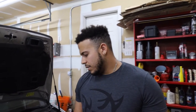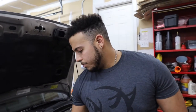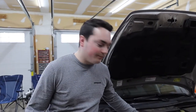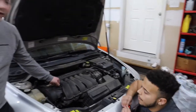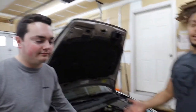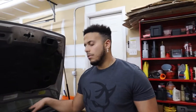If you pop the dipstick — or either the dipstick or the oil cap — I highly suggest just pop the dipstick. The howling will go away. It's a short-term fix, but I really do recommend still buying the part and not just driving without your dipstick. That's how you diagnose the problem. If you're having that howling problem, open your oil cap and when you try to pull it off while the car is on, you're going to feel some pressure — like it's sucking back in. It'll feel like a suction, and that's how you know. As soon as the cap is off, literally — we had the car on, as soon as we popped the cap, the howling went right away.